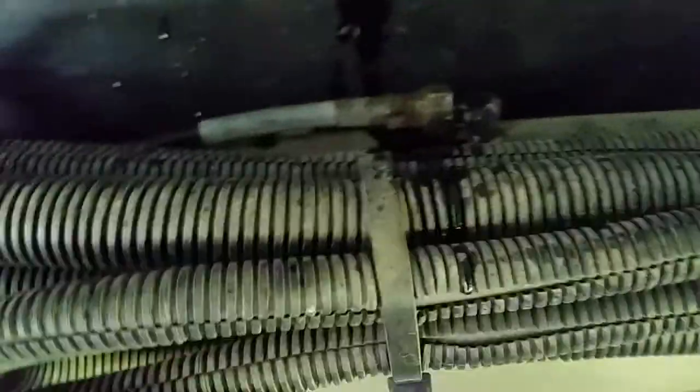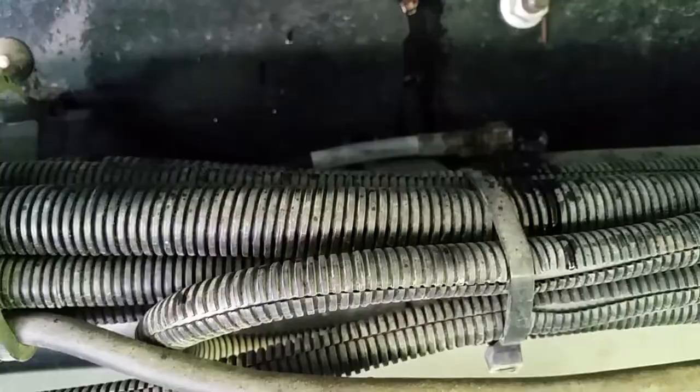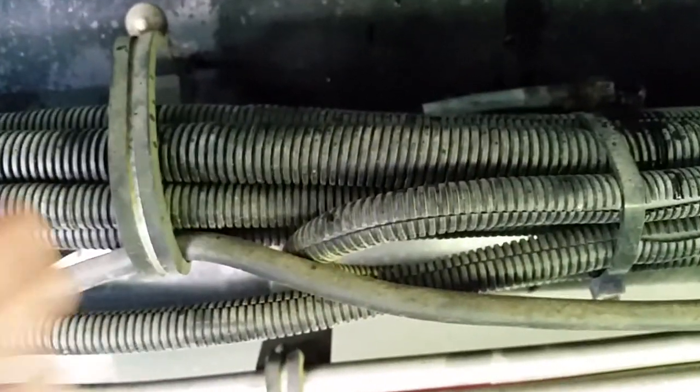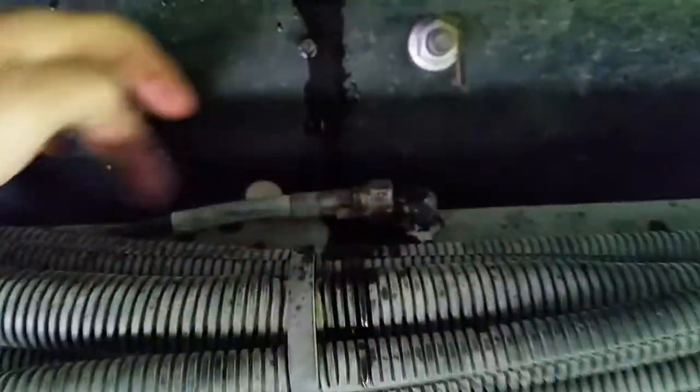And I just took this line loose, and it was under quite a bit of pressure. I tried to relieve some of the pressure by, normally when you bring in a room, you bring it in and then hold the button till you hear your pump labor. That way you pressurize and the cylinder gets equalized, because this is your equalization cylinder.